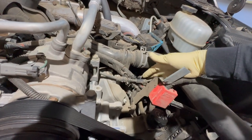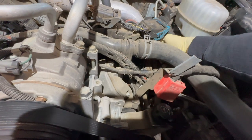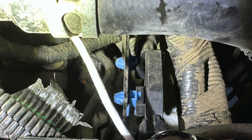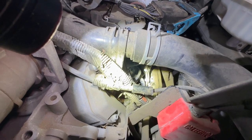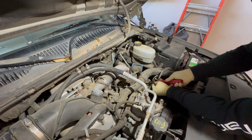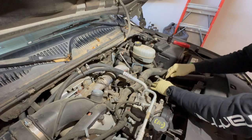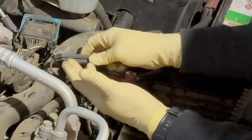The back side is kind of hard to get to, but you just pull the harness back a little bit and you can feel that connector. There are two small blue clips that hold it to the bracket — make sure the new one comes with new clips. You can just pry that off to give you way more access to that connector to release it. Use a long screwdriver or something to pry it off those blue connectors.